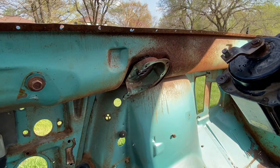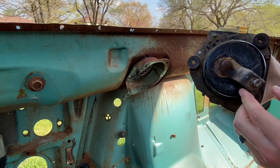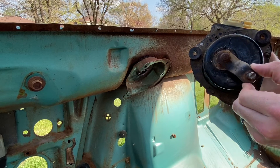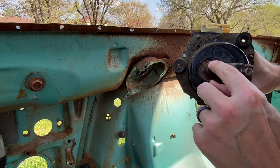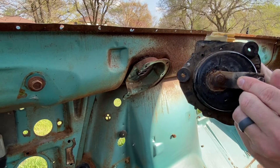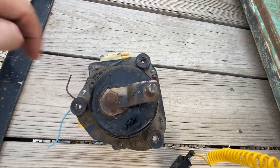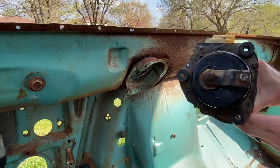When you get the last bolt out, you're going to have to rotate a little bit to bring the rotating arm through the firewall. Once you get your newer replacement motor, make sure and compare them to confirm they are exactly the same. One thing to know about is the park position on these motors. When we turn the wipers off, they need to go back to the park position. These have park indicators on the rotating arm — a small dot and a hash mark. When we go to install these, we need to ensure that the hash mark on the rotating arm is within 5 degrees of the vertical hash mark on the motor, and then reinstall it.